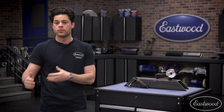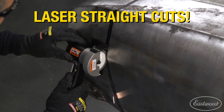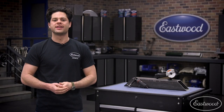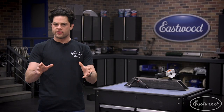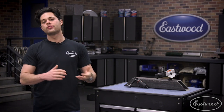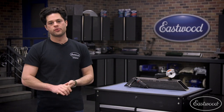Now let's say you have a rusty piece of panel that you're looking to remove and replace. There are a couple tools you can pick for that job, but none of them do it as well as the panel saw can. The angle grinder can be a little bit wavy, and on cars especially, you have to be careful to not cut what's behind the panel. The shears have trouble going around contours. The nibbler and body saw are great for those contours, but not so much for the straight runs.